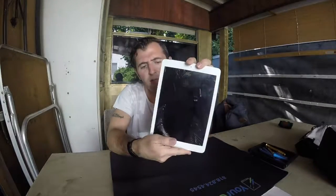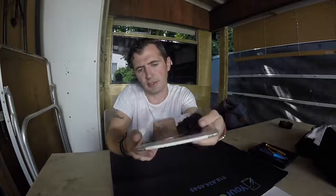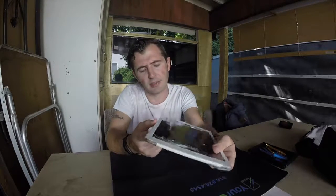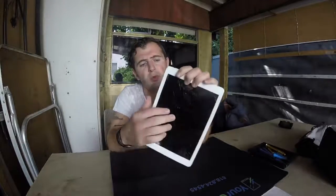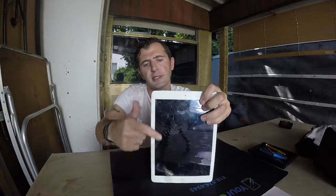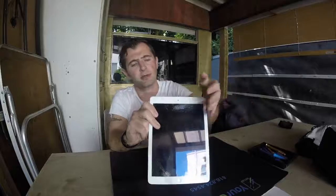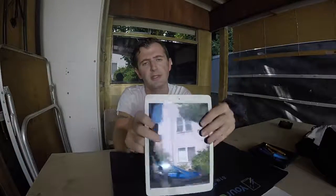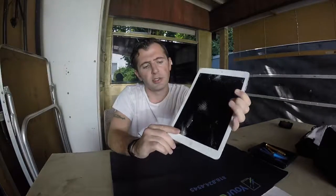Right now it just turned off because I hung it up. I heard it takes a long time because the glass to the digitizer is very seamless, but once we get in, everything should be just like any other iPad. We are going to enter from this side because there are fewer cables here and more cables here, and the thing opens up like that. The cables are actually tucked in under the LCD of the iPad Air. So let's get to it.